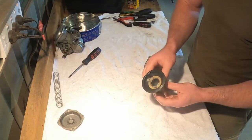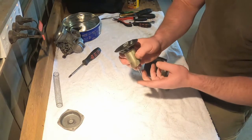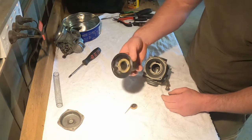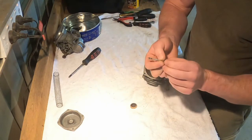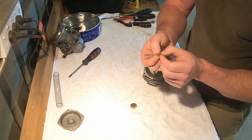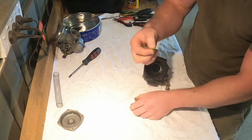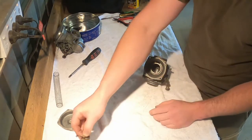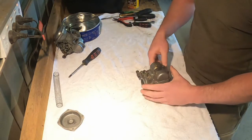Be careful with this diaphragm — if it tears you'll have to replace it. You've also got a needle in there, and you can take that out just by tipping it upside down and that whole arrangement should fall out. On these ones the needle has five slots and a little e-clip that sets the height. You can adjust that height to adjust your mixture — the higher it is the more fuel you're going to get. There's a plastic stopper on there as well. Put those aside — that's the top done.